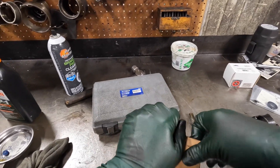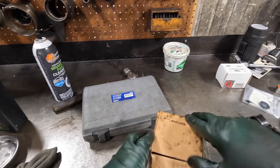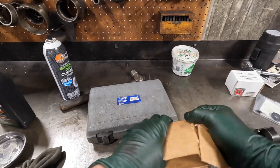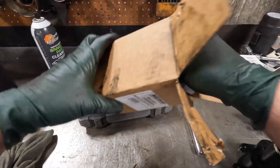The dry shaft kit comes with everything you need, so if you're not sure you can always order this. The bearings are already pressed on the shaft, and you can drive the shaft in and out with a rubber mallet if you don't have a press — though you do need a press or a puller tool to get the pulley off.